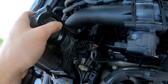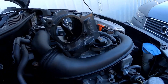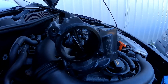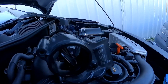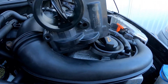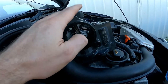The fault was causing the car not to rev over 3000 RPM — if I recall, it wouldn't make any power over 3000. On the freeway you'd hit 3000 RPM and there was nothing — you couldn't go any faster no matter what you did, putting your foot down made no difference. It's a small capacity engine aided massively by both the turbocharger and the supercharger — supercharger on the low end, turbocharger more on the high end, with some collaboration between the two. It all revolves around this unit balancing between the two and controlling the clutch on the water pump.